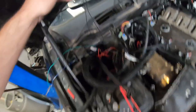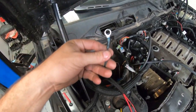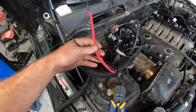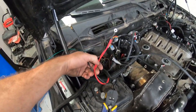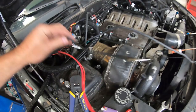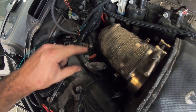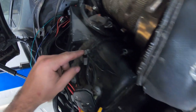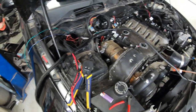We took the two black ground wires from the main harness and transmission harness and terminated them together, then terminated the solid red constant power wires together. Now we have one power and one ground wire to hook up. Right on the outside of the DME box there's conveniently a stud for constant power, and there's a ground stud — mine's hard to reach with the downpipe in the way, so I'm using the stud on top of the strut tower. Powers and grounds are hooked up.